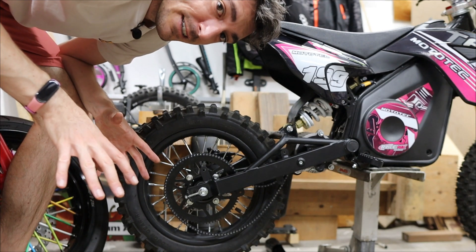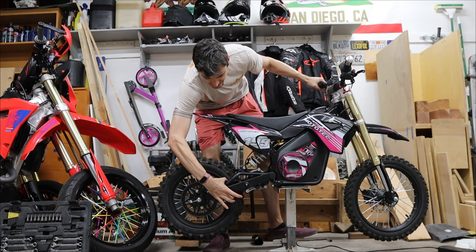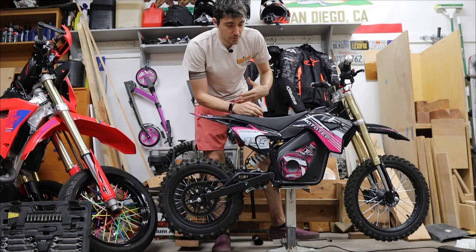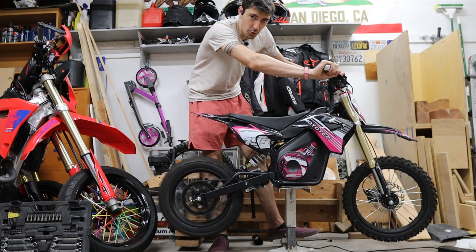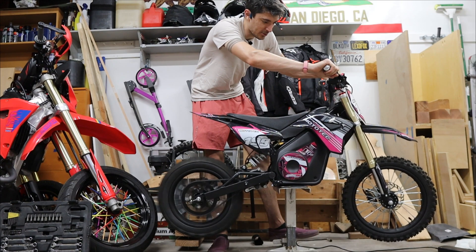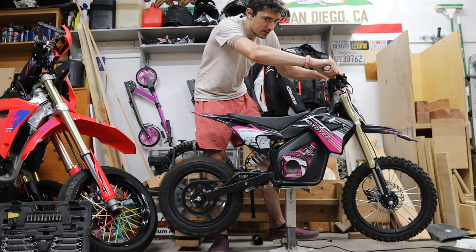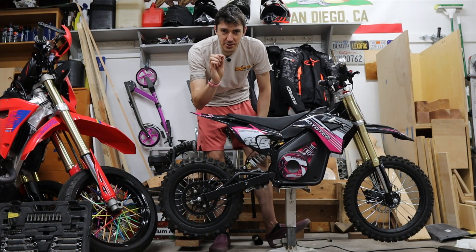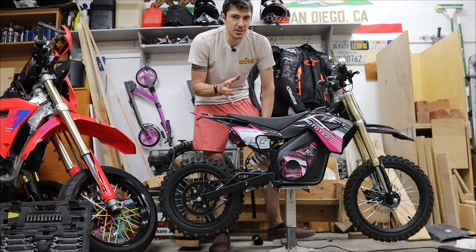Maybe I did the wrong thing twice — third time's the charm. So we got the chain reattached and everything is tensioned appropriately, there's no slack or at least very little. Now with the wheel on and actually attached to the motor, I reran it going through the whole speed range and all the different throttle positions. And you can kind of hear it now. So it's like basically in one very, very finite part of the throttle where it's just all of a sudden really crunchy.